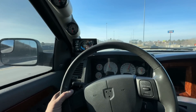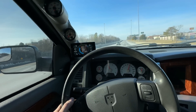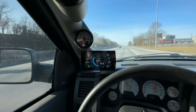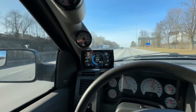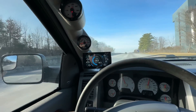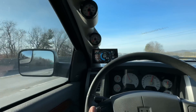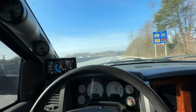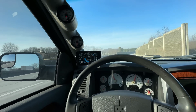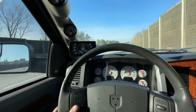This is our single injection event tune — I'd guess around 500 horsepower. We're pulling a little hill here unloaded. You can watch the boost right there — EGT is in the middle — staying relatively decent around 30 pounds. The cold weather is going to benefit us on trans temp and coolant temp. We have done no upgrades to the cooling system on either side.